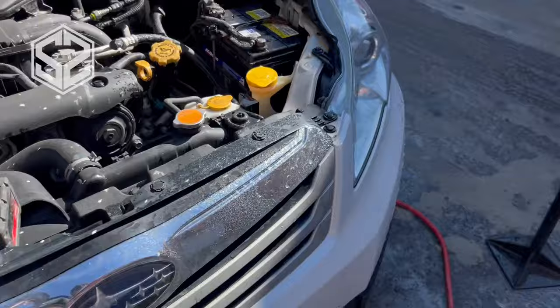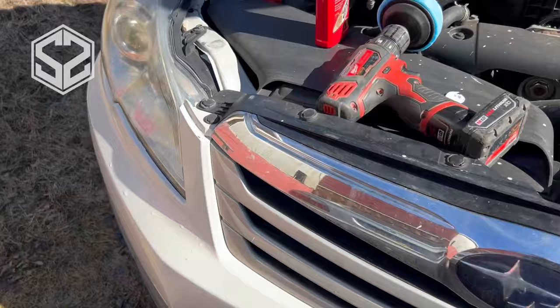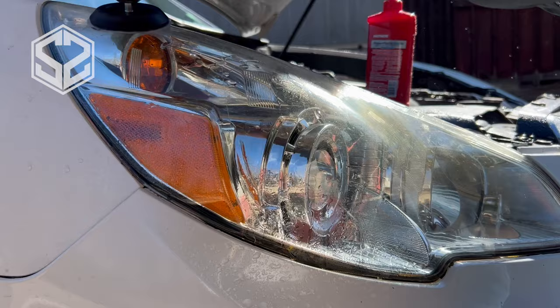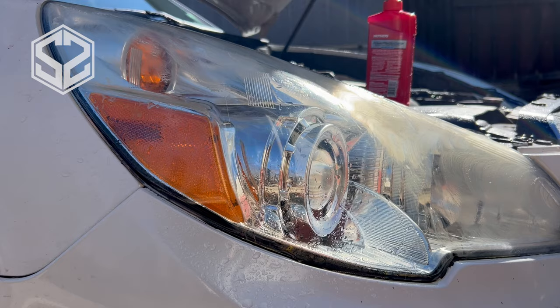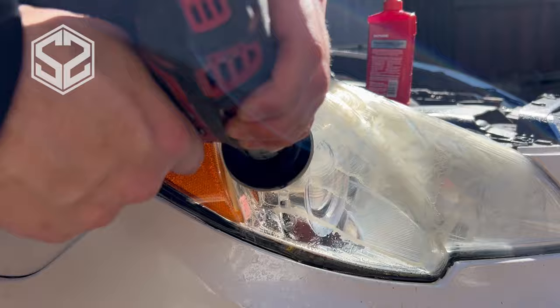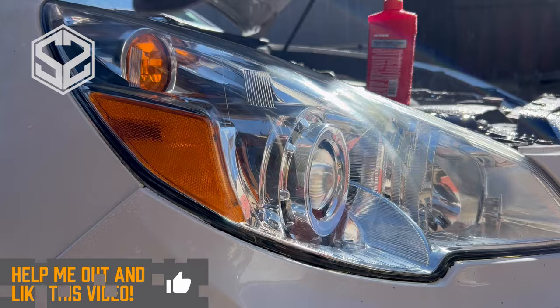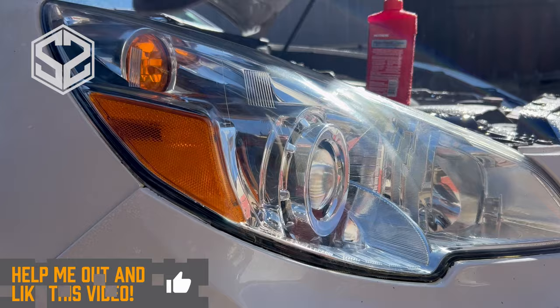Man, now I need to do this one — the clear one looks dull compared to that. That looks like a brand new light! I actually wasn't planning on fixing this headlight; it looked clear before, but now this one looks faded compared to the other one. So I'm going to sand this one down and do the whole process for this as well. One minor change: I'm actually going to jump straight to the 1500 grit sandpaper since there isn't a lot of deep damage — that 1500 grit will be plenty to just polish it up.